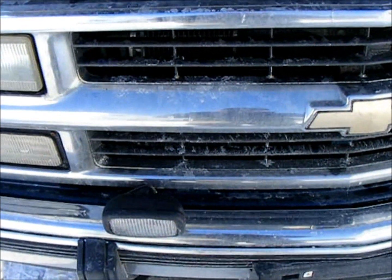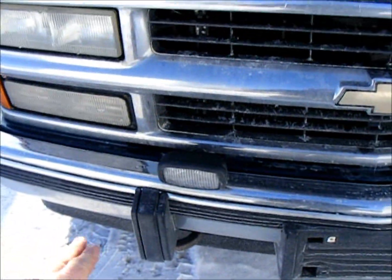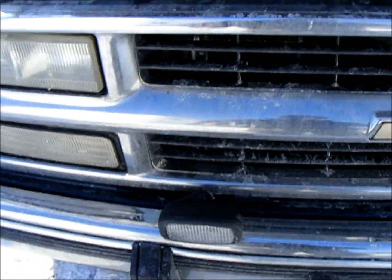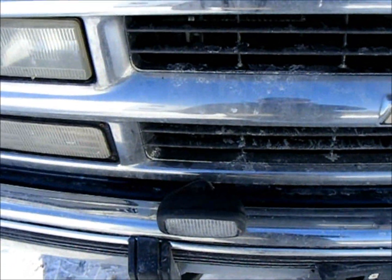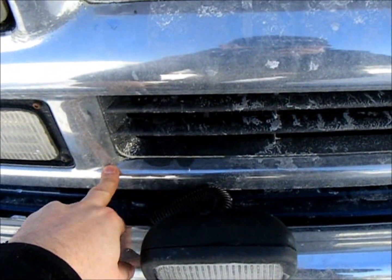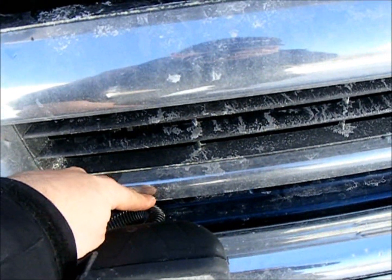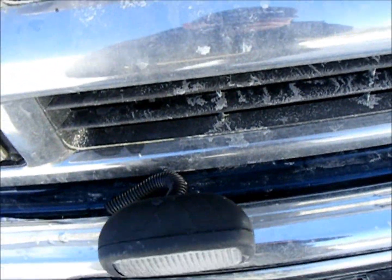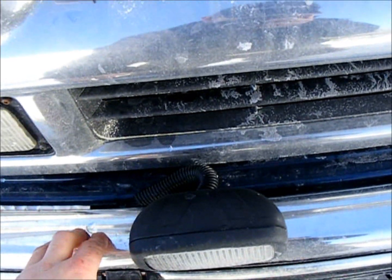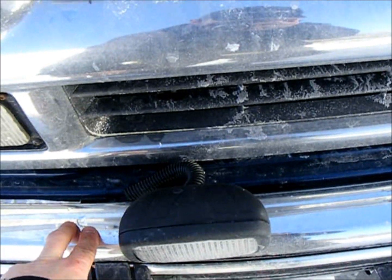The first thing I did with my truck was make sure my lights were equal distance away from my other lights, or else they would look off-sided and almost ruin the look of my nice truck. I measured about 3 inches from this corner here inward and I drilled downward. Make sure that you are not going to drill into anything first. These steel bumpers here are less than an eighth inch steel or something — they are not too bad and easier to drill through than you think.